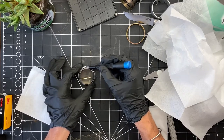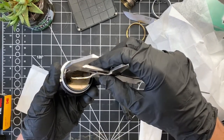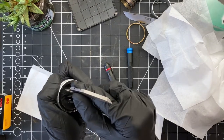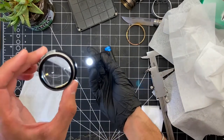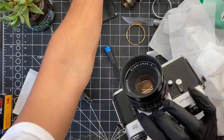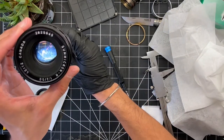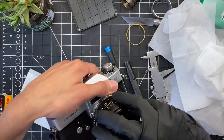Once everything was finger tight I torqued it back with the caliper — again, buy the right tool for the job if you feel so inclined. I snugged it up well but didn't want to go too far; you want to make sure nothing is moving in the final assembly. Here, once everything's assembled, you can see it's a lot cleaner — really not much debris in this lens at all, which is surprising. I compared it to my Leica repaired in a previous video and you can see how much debris is still in that camera, yet surprisingly those little pieces of dust have no effect on image quality — it still takes beautiful photos.